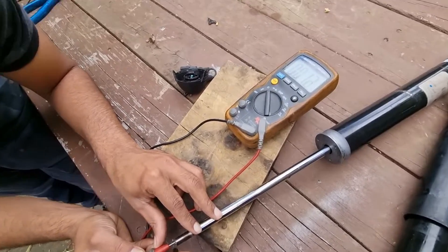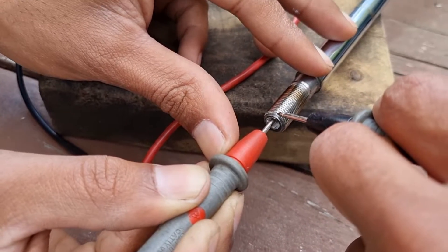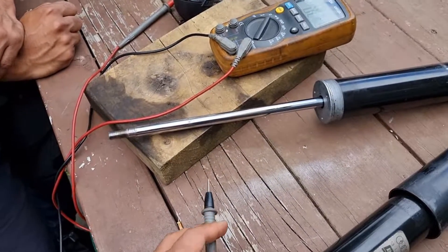That's the body of the shaft that we just measured. Now we'll measure the internal — this will be the internal positive to the coil. That's the first pin to the square that we're measuring. So if we hold the ground here and the positive goes into the center, we should be able to measure the coil on the shock. As you can see it's about 1.3 ohms — actually the same as what we measured before. For reference, that's where we're measuring, just in there and there.